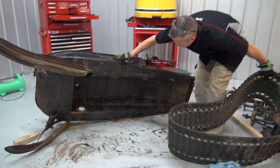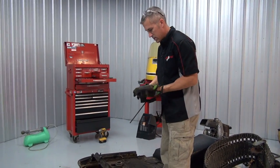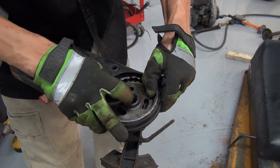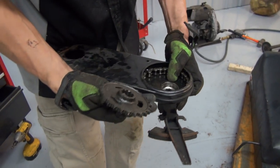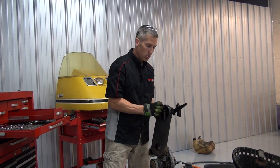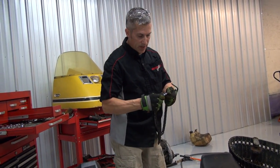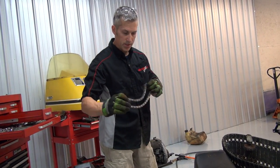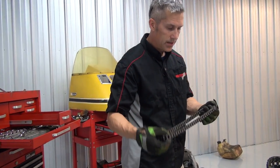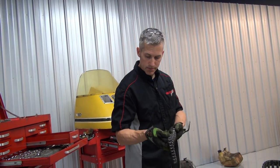It's coming along. The chain case comes right out. Spread it away from the gear. That gear's pretty good. Unless I know that this chain has been replaced recently, I always replace these. Never reuse a chain on a 40-year-old snowmobile — you're just looking for problems. These have been stretched out, the rollers are probably cracked, maybe the links are cracked. You don't want to do a restoration, have the chain break, and then have it box up inside your case. That's not a good thing.